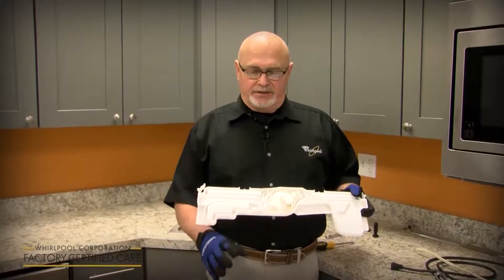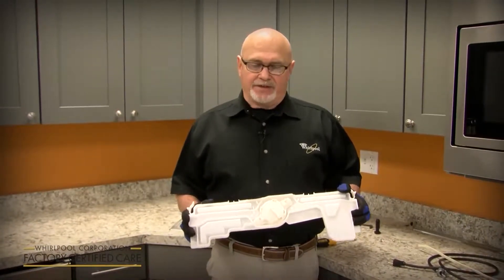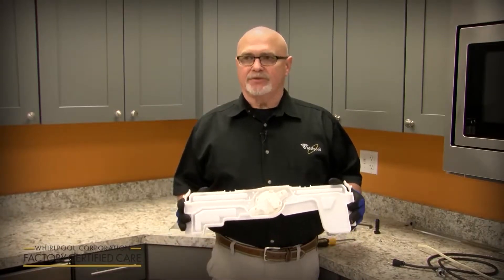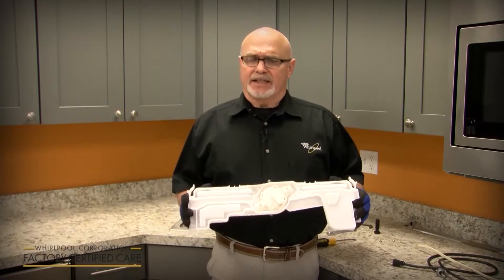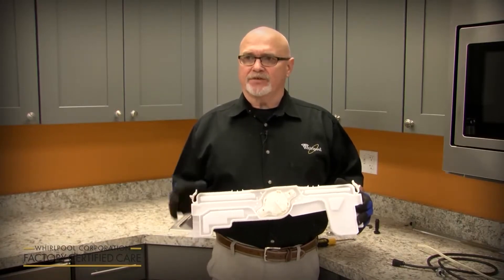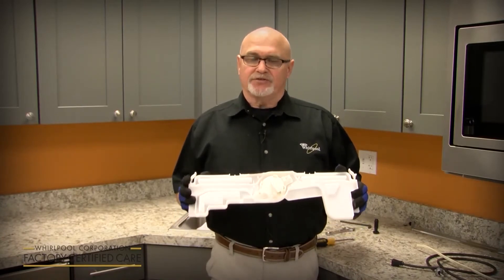If you're successful, all the LEDs will come on and then you can rapid advance it through steps one through six. Step one is drain, step two is fill, step three is wash. It's a short five-minute cycle, or you can rapid advance it to whatever portion of the cycle you want — just make sure you're doing this so you can check for leaks.